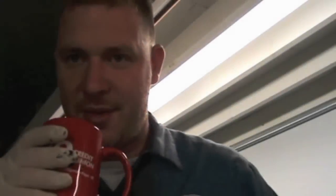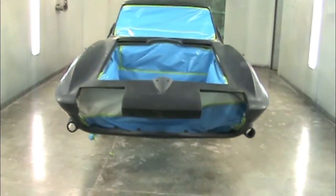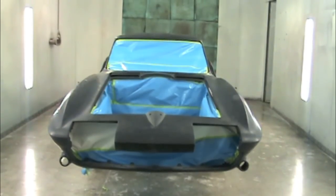I'm going to take the DX 330 wax and grease remover, wipe the car down, and then apply booth coating. I'm enjoying some day-old coffee here, but I need to get the sealer sprayed because I need to wait about an hour for that sealer to harden up before I can safely spray the lacquer — I don't want the lacquer to react with any of the sealer coats, because it'll cause it to grain and curdle up and do all kinds of bad stuff. For the booth coating I'm going to just put it on the floor — it's a 3M product that stops dust and it works really really well.